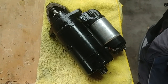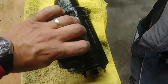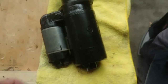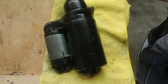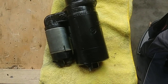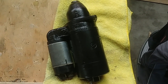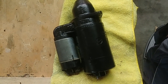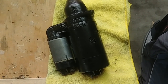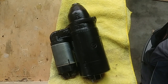Here it is, guys — reassembled, lubed up, new bushings, everything painted except the starter solenoid, which is zinc coated so there's no need to paint it. All the contacts are cleaned. This is now functional — not fully rebuilt because it still has the old brushes in it — but a clean commutator, clean rotor, everything clean inside, freshly lubed up and functional. It's going in a box and when I have time I'll throw it in my bike. I hope you guys enjoyed this video about rebuilding an airhead starter. Keep wrenching — you can do most of the work on an airhead yourself if you put your mind to it. Give me a thumbs up and subscribe, take care.